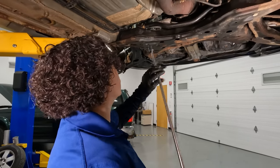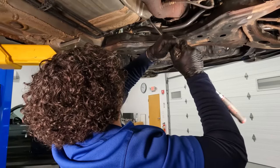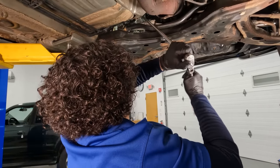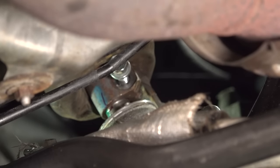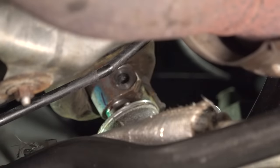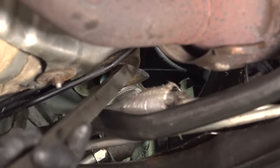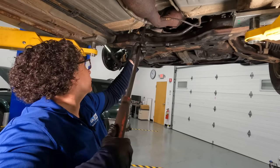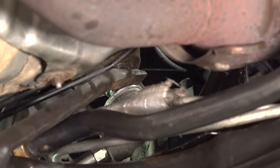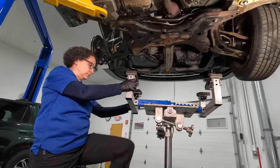Now that I've marked it, I'm going to take a 12 millimeter swivel socket and a long extension and get right in there and hopefully break this free. You can see why it was so important to make sure that steering wheel sits still — because the rack is the shaft, it's going to want to turn. Now that the bolt's off, I'm going to take my pry bar and manipulate it a little bit to make sure it comes off that rack, because the whole point is for it not to come down with the rack. I think it's going to come down a little bit as the rack drops, so we'll pay attention to that while we support the rack and lower it.